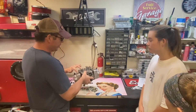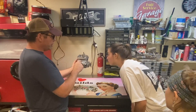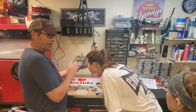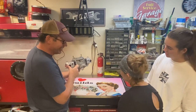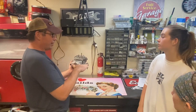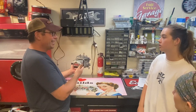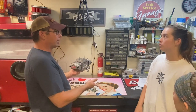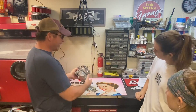It's got sight glasses on all four sides. When the carburetor is on the car, you tune the float level and you can look into the little glass and see where the fuel is. A lot of carburetors from the factory don't have those — they just have a hole. What you used to do, this sounds crazy, is take the plug out with the car running and bump the fender of the car. If fuel comes out, then you have your float set correctly. Like, we're literally bumping fuel onto a hot motor. To have these sight glasses on both sides is really cool.